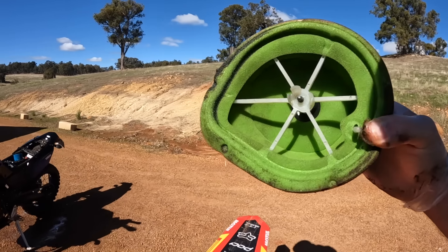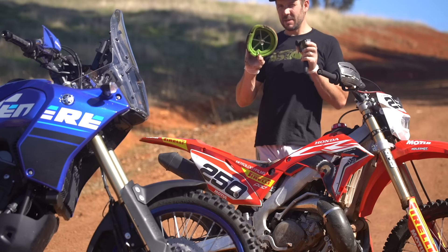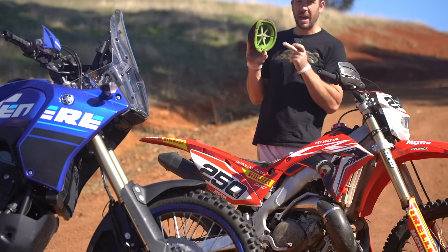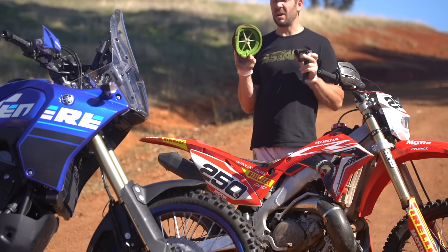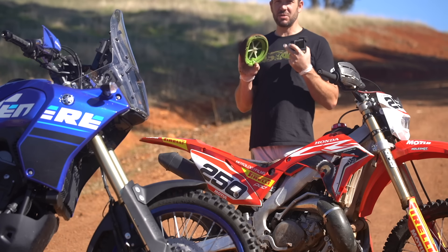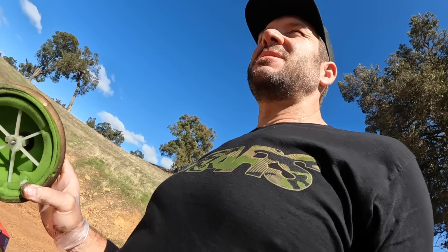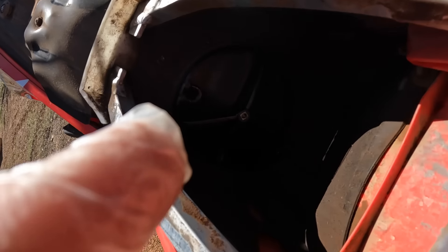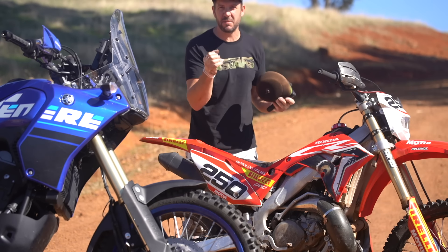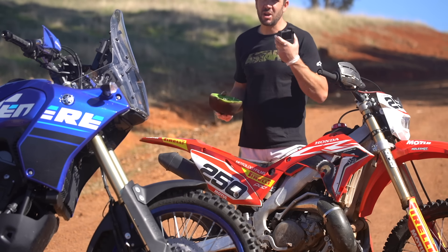That's the dream — properly oiled, completely oiled. When the day comes that you see a 50 percent patch inside your air filter that looks like the outside, you will feel sick to your stomach. You've left a dry spot in the foam, and it's the path of least resistance. The engine just sucks in that dust and you have no idea. Then you look down through the air box boot to the mouth of the carby or throttle body and it's like someone's thrown a handful of cocoa powder in there. Your engine's toast.